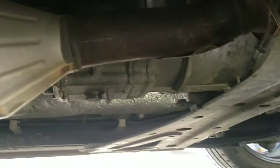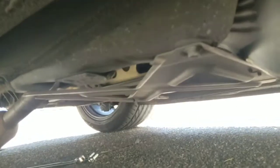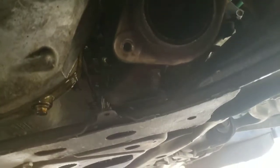The video cut out, but basically the only way I could get access to these two nuts is by removing the mid pipe. I got it disconnected at the muffler and removed it from the hanger; right now it's caught up on the x-brace. If I take the x-brace off, the mid pipe will come out. By removing the mid pipe, I gave myself better access to those two nuts right in the center of the screen that I need to loosen — now I should be able to get to those without the mid pipe getting in the way.